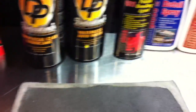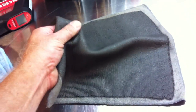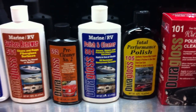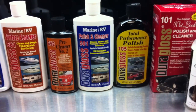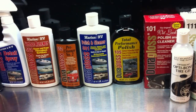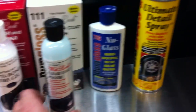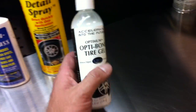For this process tonight: we first started out using the Detailer's Waterless Auto Wash just to get the car clean. Then we used the Detailer's Universal Clay Lubricant with the Speedy Prep Towel to clay the whole car. Then we went into the Dura Gloss 501, using a variety of tools — rotary buffer and DA polishers with different foam pads. We avoided the wool pad because we found out this is a single stage metallic finish — if you buff too long in one area you can change the appearance of the flake, and running the rotary back and forth gives it what's called tiger stripes. Once we knew it was single stage metallic, we used the rotary only on the deck lid and hood, then switched to DA polishers for the rest. For wax we used Dura Gloss 111 clear coat polish. We used their new glass cleaner to machine polish the water spots off all the windows, and then used OptiBond tire gel for tire dressing.